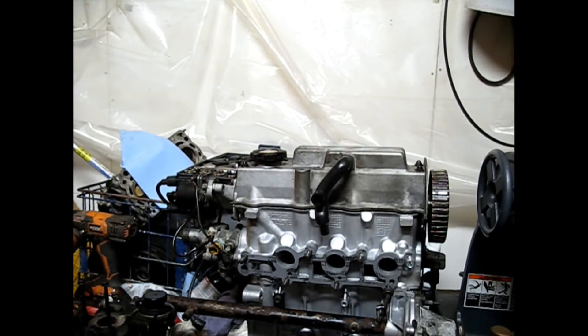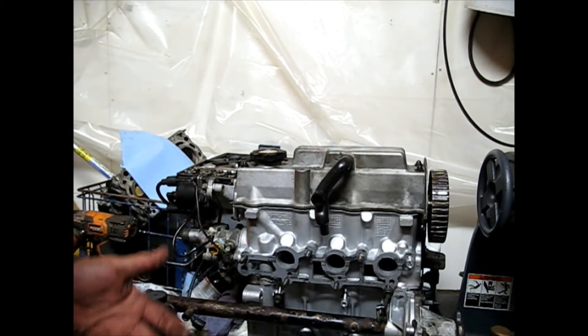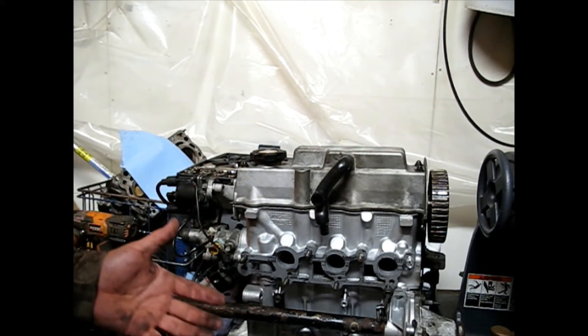No matter what you would have done with this engine, it would have still run like crap. Even if you fully rebuilt your long block, you'd have bolted that intake manifold back on and been completely screwed — wondering why your engine wasn't running right, why the emissions weren't as good as they should be. You could have idle problems, all sorts of issues with fully blocked EGR passages. So go through everything when you're cleaning it up. I'm going to put a brand new EGR valve on it. There's never going to be an easier time than when you have it in your hands, off the car — do it now.